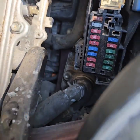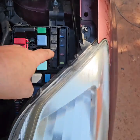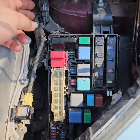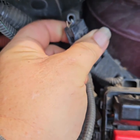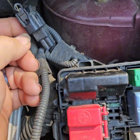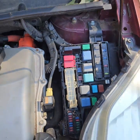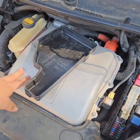Now your inverter pump is right here. It looks pretty simple to get to — famous last words. Change this fuse. Then you're going to get in it and restart it. And if this fuse blows again, you can unplug the wire — it's a white wire with a black chaser, that one right there. You can unplug this wire; this is what feeds the power to your inverter pump. If you unplug that wire, you should be able to drive it a short distance.